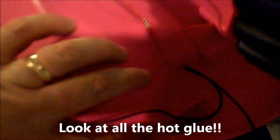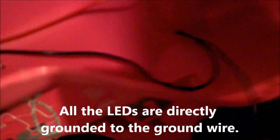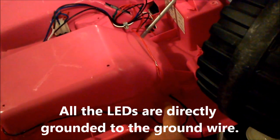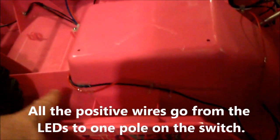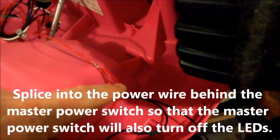So I have these LEDs over here — they're hot glued down. I got it glued over here and occasionally around here. The wires come over here, then they splice out and have another LED right here — another two LEDs. I spliced into each of the wires to get the positive and negative connections, and this will be six volts going through here. Then the ground wire comes over here and connects up to this wire, and this wire goes up to the LEDs in the dash. I drilled a little hole down there for the wires to go through to go to the dash.